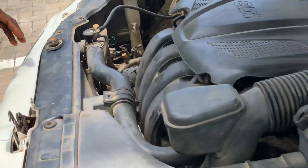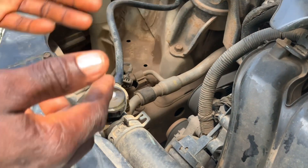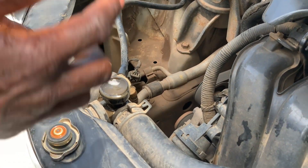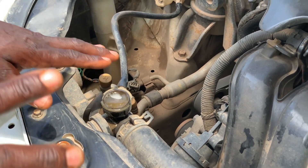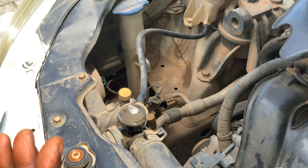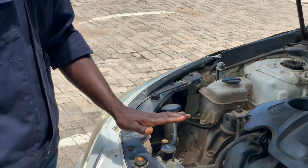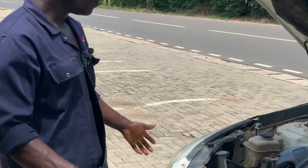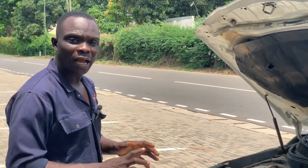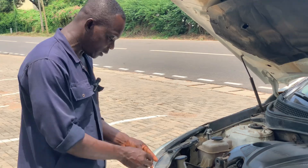This is normal circulation, not a boil-out. This is a pressure tank. If it is boiling out, the water will come out with pressure and can spray upward. Normal circulation means this car has no overheating issue. But if you start it and the water boils out immediately like that, the car has overheating and it has affected your head gasket — that means you have a blown head gasket.